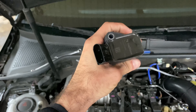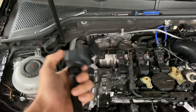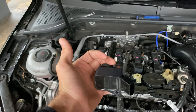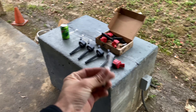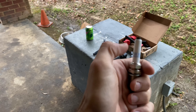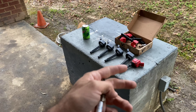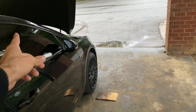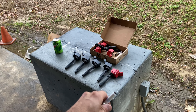After you get the stud out, the coil should pop right out — just like that. I just talked to my tuner and he said he already put Audi RS7 spark plugs in, so we don't need to change those. I'm just going to drop in the Velt performance coil packs and we should be good to go. Typically when changing coils and spark plugs, they'll give you some grease to go on the threads and the boot area of the spark plug so the coils come out easily in future. Since the RS7 plugs are already in, I'm just going to stick the new coils in.